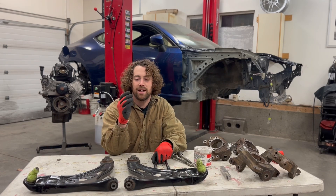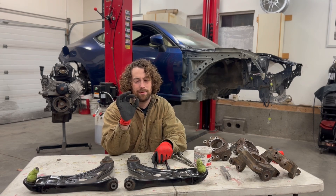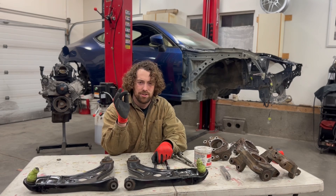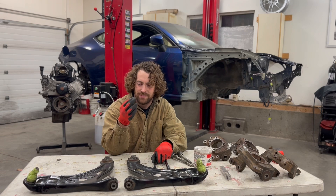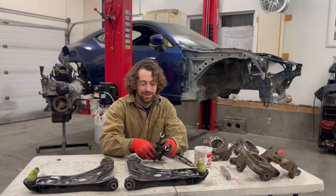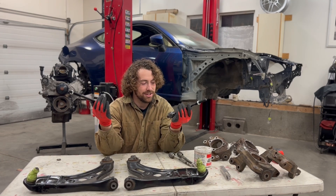It's just easy and they're cheap. On top of that, rack spacers — I had these cut out on a friend's waterjet. They're one inch outside diameter, five-eighths inside diameter, and just a hair under a quarter inch thick, about five millimeters. These let the rack move more and give you a little bit more turn on the steering wheel.